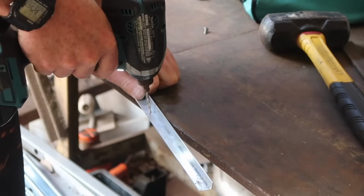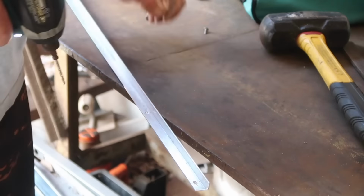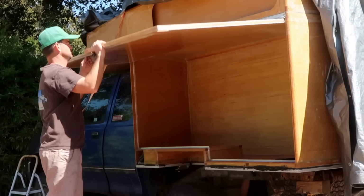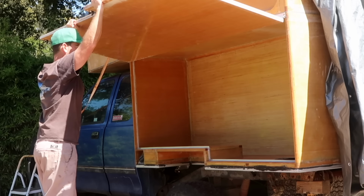Next, just like in the utility hatch, I installed pieces of 1/2-inch aluminum angle around the inside of the storage area with No. 6 panhead screws and adhesive. I slid the door back on, and everything seemed to test fit nicely at this point.